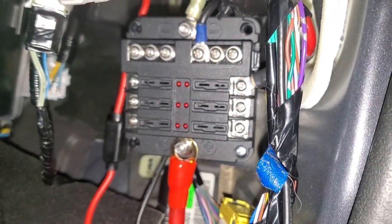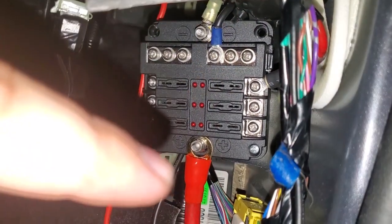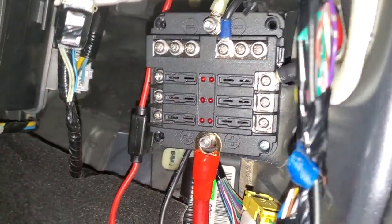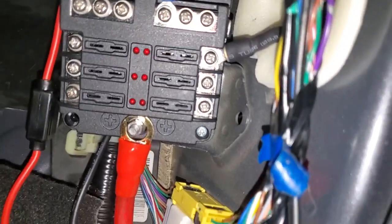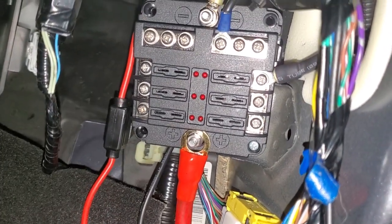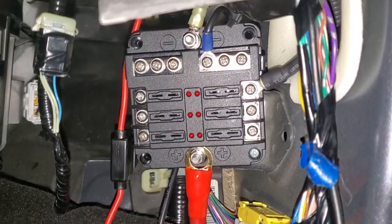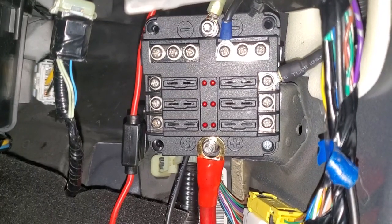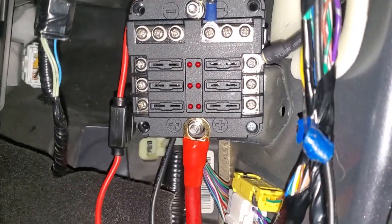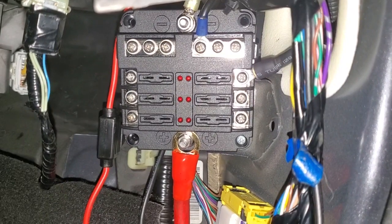This fuse box I got on Amazon — I'll put a link in the description if anybody's interested. You have six circuits: grounds at the top, positive at the bottom. Right now I just have one hooked up — you can see here to the right where the HF rig is hooked up, no fuses in it just yet. The box is made to do 100 amps per box maximum, or 30 amps per circuit maximum, so you obviously can't run four 30-amp circuits. But in my case, I'd have to key up two radios and have the stereo blaring all at one time to even come close to 100 amps. This is, in my mind, the most proper and legitimate way to get extra power into the vehicle — efficiently, safely, and with room to grow.